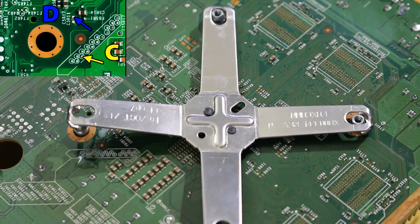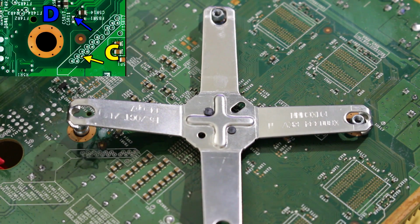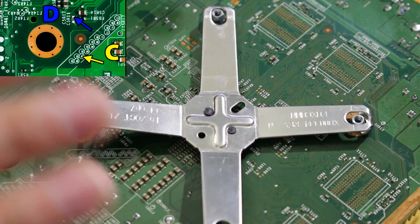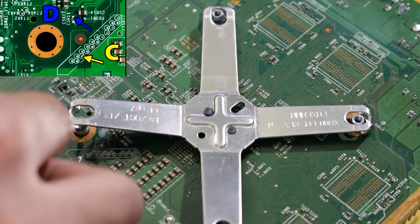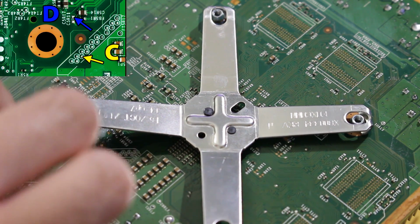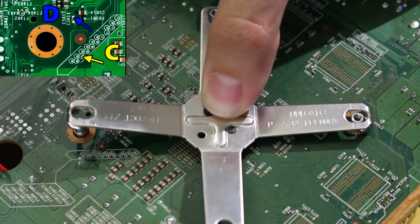So now we have both these points tinned, so the hard part's going to be figuring out which wire goes to what. So you kind of want to gently flip over the board, take note of which wire is which. In fact, you might just want to run one of these at a time, which might have been better in hindsight, but too late, we've already done this. What I'll do here, actually, I'll just go ahead, get rid of one of them, and I'll flip this over gently, and we can see.